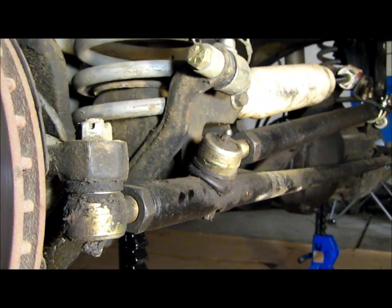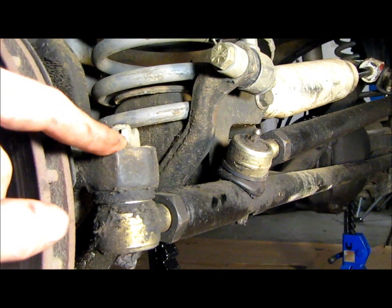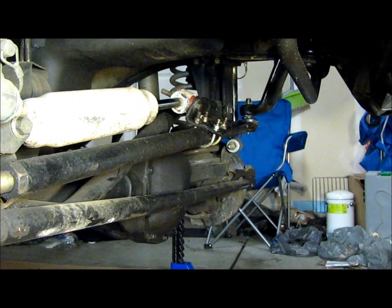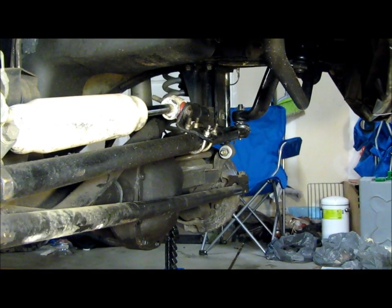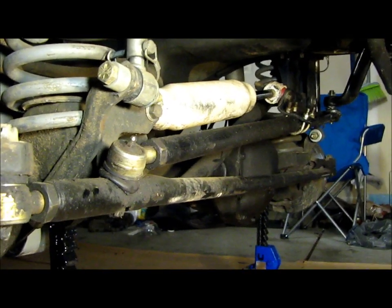But I went with the heavy duty 5/8 inch hardware upgrade. I think it was only $20 more. So we're gonna actually drill these knuckles out. I got a 5/8 drill bit. We're gonna drill the knuckles out, and I think there's one more thing we gotta drill out. I don't know if it's the pitman arm or one of the clamps up there on that end, but we'll get that all drilled out, and then we'll have a solid steel tie rod and a solid steel drag link over the knuckle, and that should take care of my steering problems.